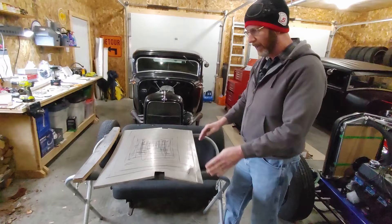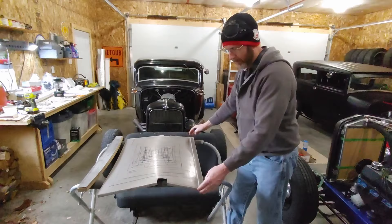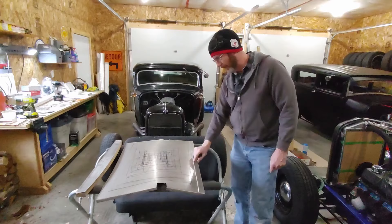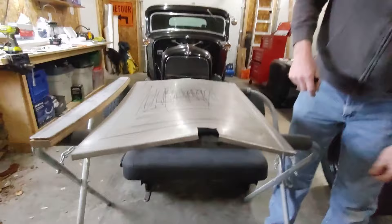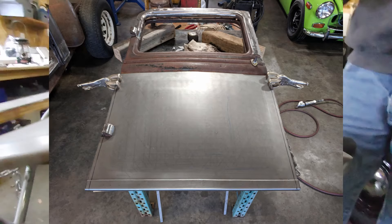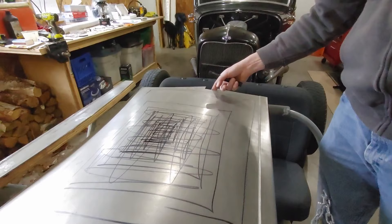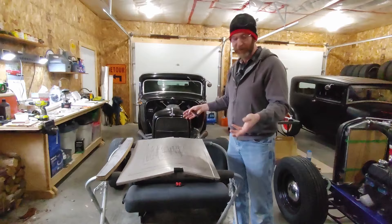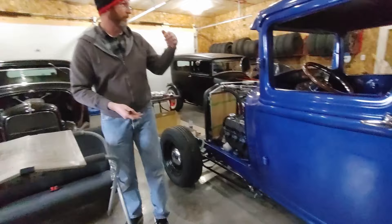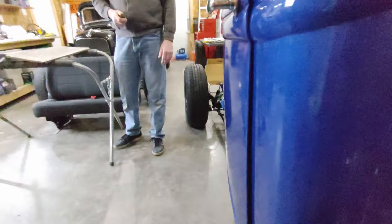Once I had the crown onto it, I first put it on the bead roller and formed the bottom piece. Then I measured up the width and length, took it over to the brake, and put the bends on it. The reason this particular panel is the first one is because I had cut the hinge on the wrong side — otherwise it would have been a perfect panel. It took me probably an hour or two to get it right — good practice. I made a second one; it's on the door, and then also on the other side of the car. Both doors were basically crushed and both had the same kind of repairs to be made.